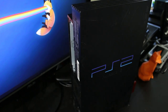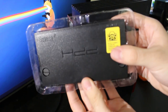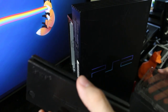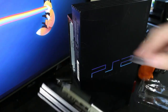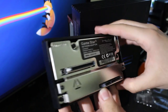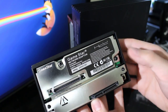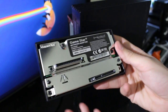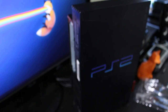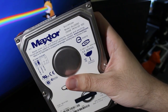So I was looking at other options and I'd seen these before — we're going to be checking out this thing right here. This is an off-brand network adapter, and you're correct if you guessed that, but there's one big difference. This thing is actually SATA. This is obviously a third-party one by GameStar, not by Sony, and it uses SATA right there on the board as opposed to IDE. The nice thing is with SATA, hard drives are everywhere, you're going to find them all over the place, and you're going to pay a lot less for storage. I paid 25 bucks for the 250 gigabyte drive brand new — you can still get it for that price.